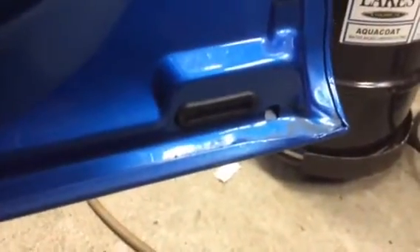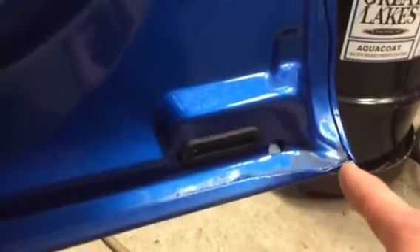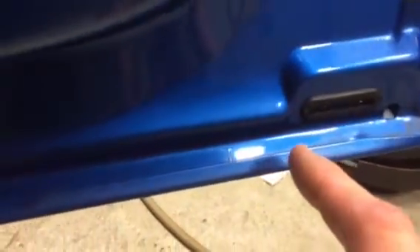Here's the end result after a good bath — removing all the salt residue that was built up inside this door flange. So it's nice and clean. The good thing is you can still see the rust proofing on the flange. Those areas right there, you can see — looks like I should probably put a little bit more on there, but it's still in good shape.